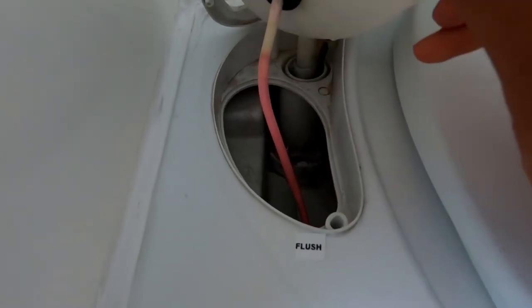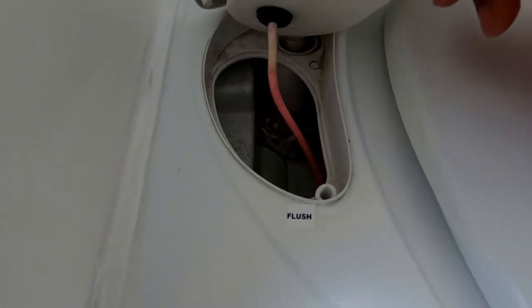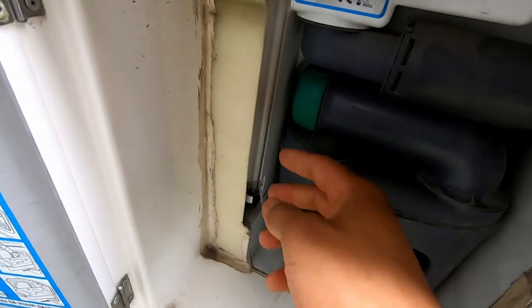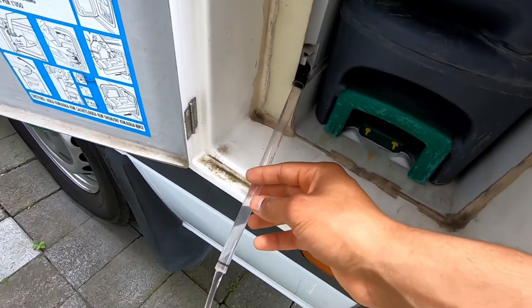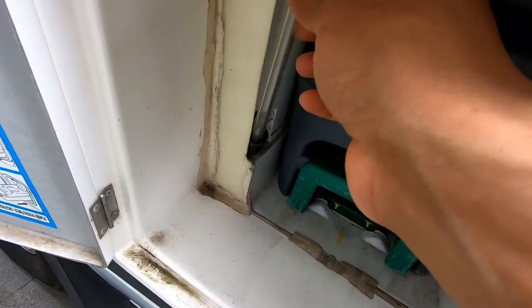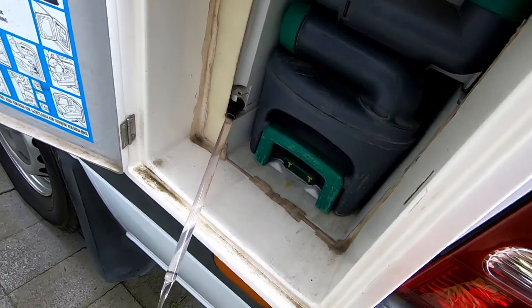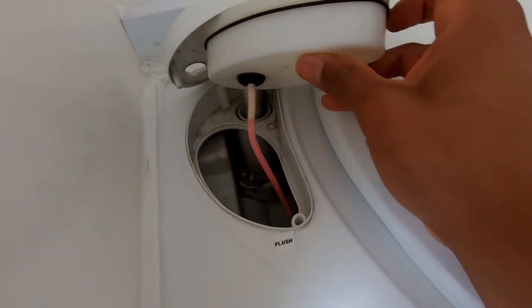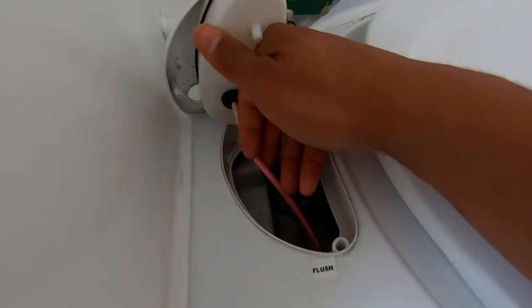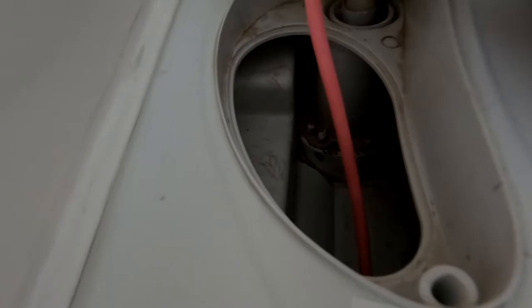Also another thing I didn't mention — we'll go back outside and show you. If you're opening the area up, make sure you drain out your flush like so. That just clips in there and you just drain that out, drain out all your water. When your water is drained you can follow this wiring and get access to the pump — you'll have to stick your hand in there and pull up the pump in order to replace it.